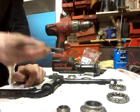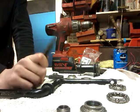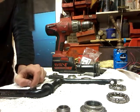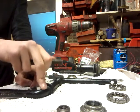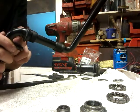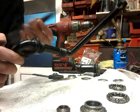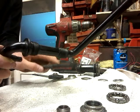So I'm going to go and see what length this will give us if we add another 10mm to this. Then I'll have to do some research on what bearings I'm going to use and see how much space we've actually got to work with. This spindle is designed to allow stunt pegs on. Whether that will allow room for however far we're going to screw this into the pedal arms, and the bearings which are going to be attached to the flat plate on the end of the forks — that depends on how much we need to cut off this crank. Because the crank has this lip and the two threads, and since they're threaded they won't fit where the bearing goes. So I have to put this in because this is a uniform size — the two threads are different sizes. So I'll go and measure up.